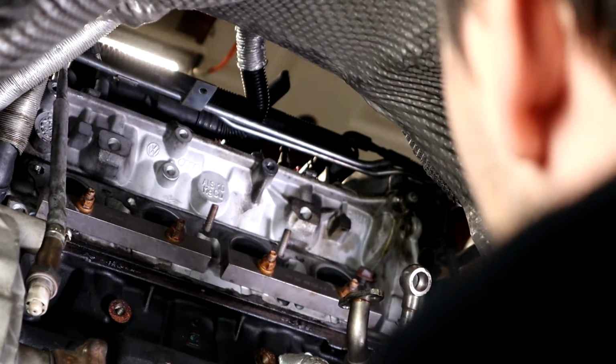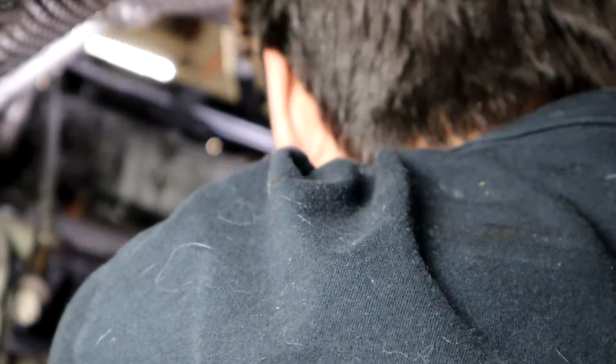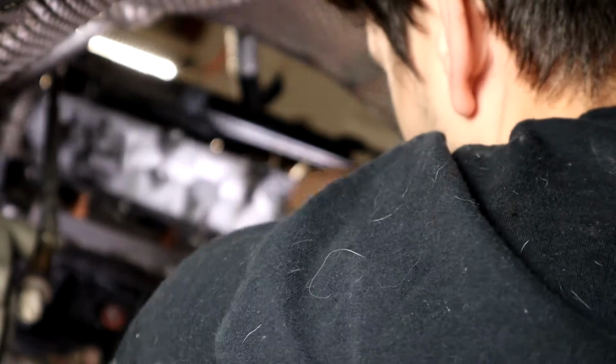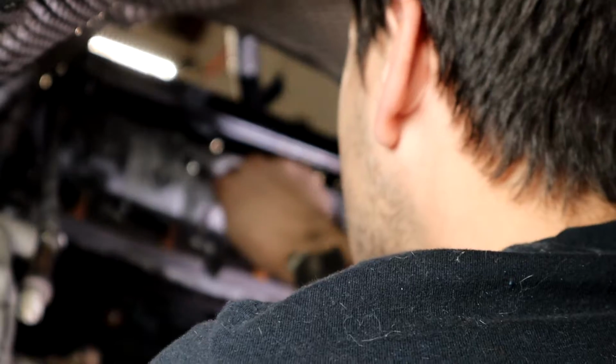Alrighty, well, I welded a nut onto the stud. I'm hoping it just comes out. It's working! Wrench is hot! Best case scenario, people, is that you have enough stud broken off that you can weld a nut on. I got lucky and it didn't break flush. And as you weld it, it kind of superheats it, so that helps break it loose.